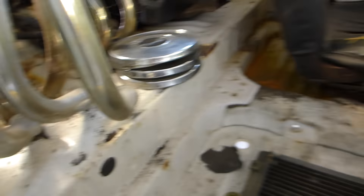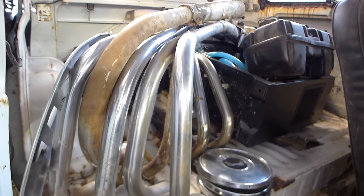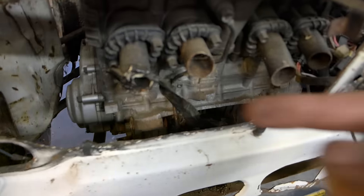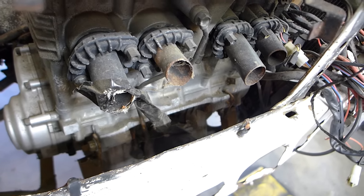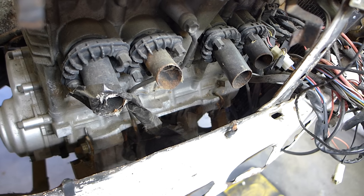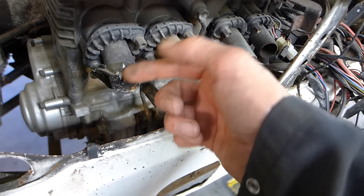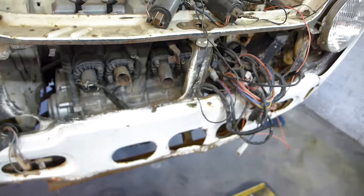I'm trying to figure out which wires go back to the fuel tank, which is underneath the back floor. I've been collecting motorcycle exhaust trying to determine which ones might work for this car. I've also got a Honda Civic radiator because I think it's going to need more cooling. One thing that's held me up is making the exhaust — I've got to make a super sharp bend, and I don't like a bend that tight; it really constricts the high-RPM efficiency of the engine. I want it to flow as best as possible and stay within the car's body.